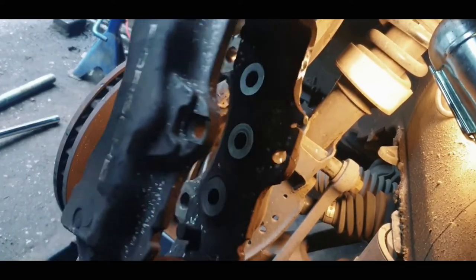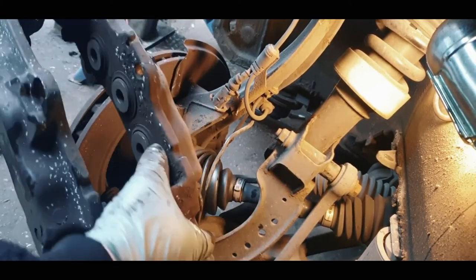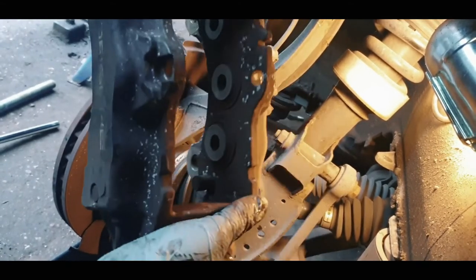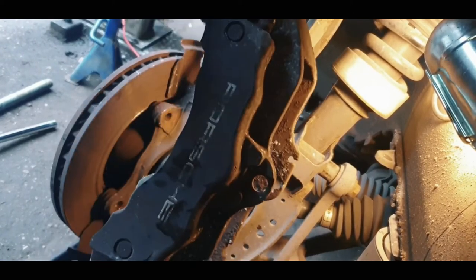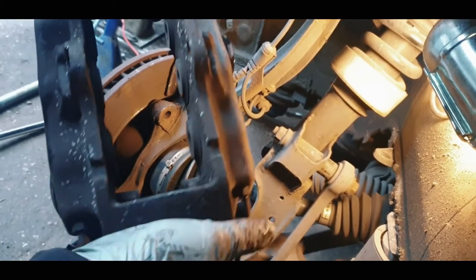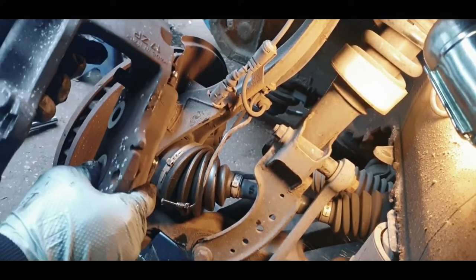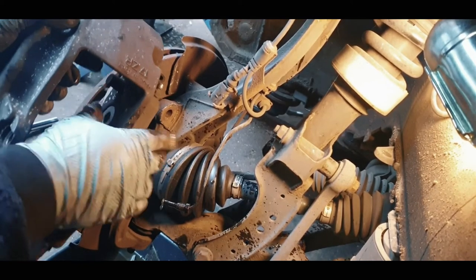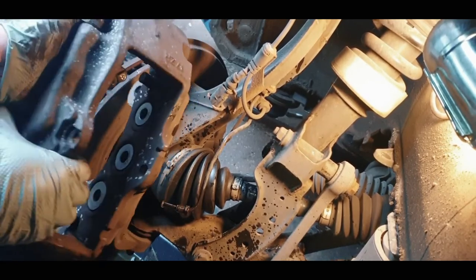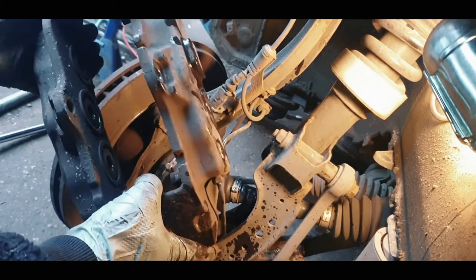So that's how you take off a retainer clip, brake pads, and the caliper. So here's the pistons. 6-pot, here's the 3 pots here, 3 pots there. And on the Porsche Carrera, where you hear 4-pot calipers, it's 4 of them. So all 4 pistons should push in and out when putting back in. So you'd have to push all, oops. All of them just go in by hand. Yep, if not, you get whatever tool you have. But this one goes in by hand, so it's really nice.